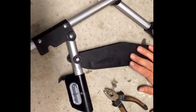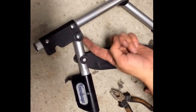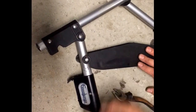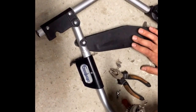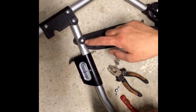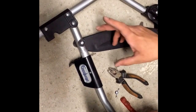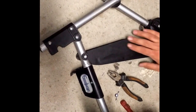The next step is to drill out this rivet and the rivet from the other side. When you're drilling a rivet, you want to drill from the side that has the ring and not from the cap side, and you want to use a completely new drill bit — or one that's been used at most once. Don't use old drill bits, because you're drilling rivets that are holding plastic parts, and if the drill isn't very sharp and quick to remove the rivet, then the rivet will start to melt the plastic, which will deform the parts.